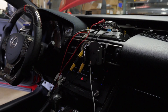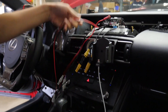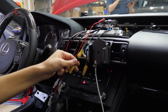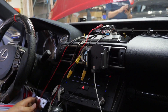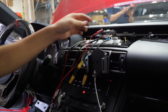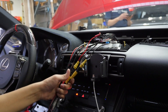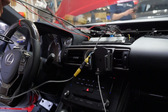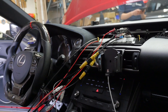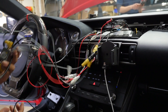We went and routed the wires from the front of the car through the firewall, behind the footwell, all the way to behind the screen. There's space on the side where you could actually fish the wire through — that's what we did. We had to fish both the front camera RCA wire and also the front camera power all the way here. We went ahead and used the supplied wire tapper and tapped the front camera power to our harness that comes with the front camera interface so that you don't have to tap into your factory wire. We have all the connections in place, tested the front camera — it's working like it should. Now we're organizing the wires, tucking them nicely behind the screen, and zip-tying and organizing the wires in the footwell. After that, we'll be done — pretty straightforward.